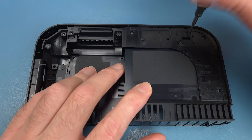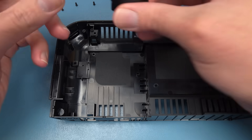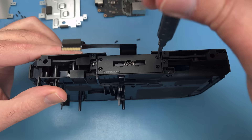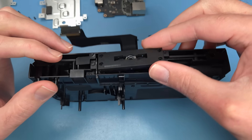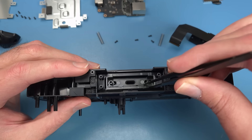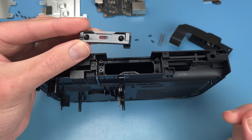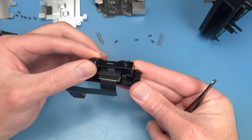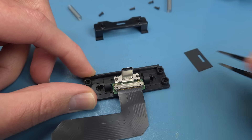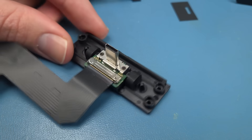The back cover has two clips for the back door panel and the fan exhaust channel. Back to the underside of the dock, I can remove the USB-C dock connector. It has two springs which gently drop the switch down onto the USB-C plug. It's also got a spring under the connector to give the plug flexibility.